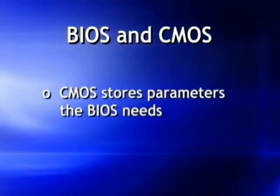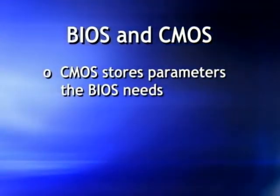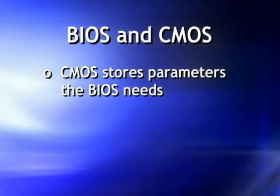What is the BIOS? That sounds like a funny name. The BIOS is actually a chip on your motherboard that contains a whole bunch of little teeny tiny programs that are used by the CPU to allow it to communicate with everything on the motherboard, that allow it to communicate with RAM, with the keyboard, with your hard disk drive, with your floppy disk drive, and so on. Before you do that, you have to set up some parameters. The CMOS chip stores the parameters that the BIOS needs in order to communicate with these various devices.